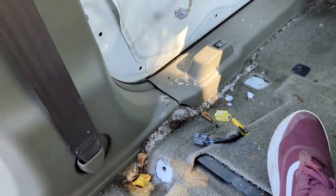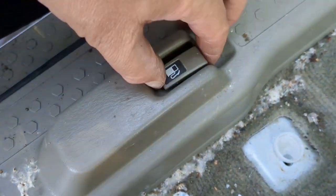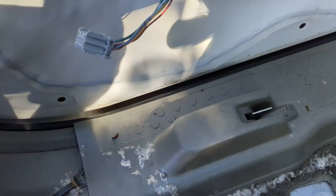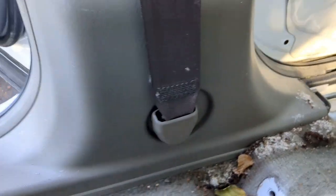You are going to open up your front door. This one here, you've got to deal with your gas filler puller. You're going to grab it, slide it forward, and then same as the back one. I'll use the panel popper, get underneath the edge, pop it up and free. That will allow that to separate. This one has two plastic clips and then a metal one behind the gas filler door opener lever.